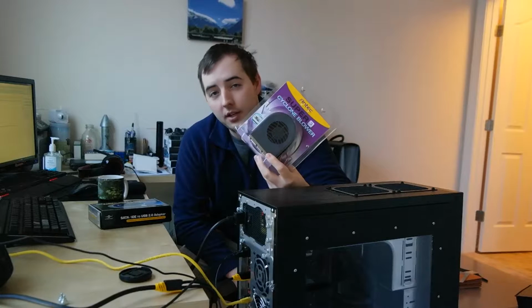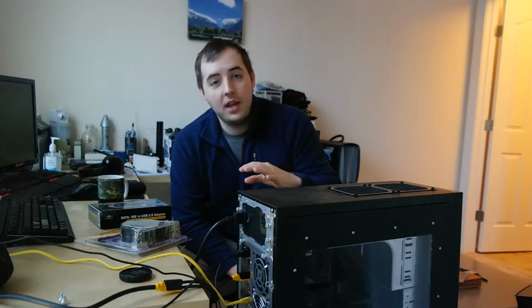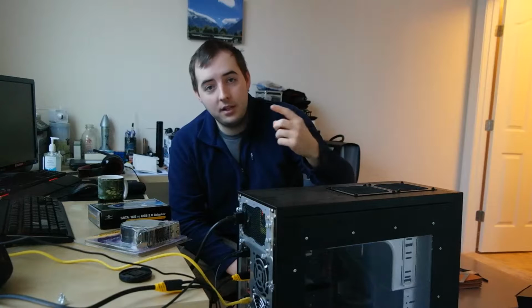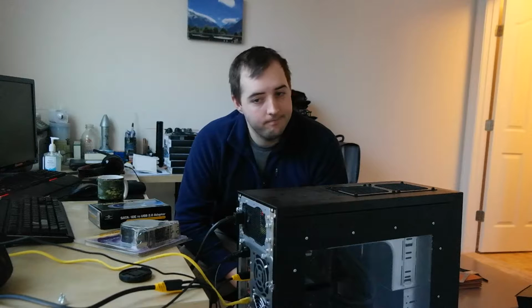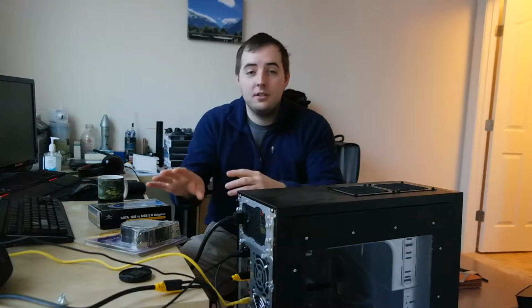What I'm really trying to do with this is just get the hot, stagnant air from the bottom of the case out. It'll be pulling from the same region that the GPU fans themselves are pulling air from to go up, only this will be pulling it down and out, so I don't know what that'll do. Hopefully this will mostly get better airflow underneath the GPU, and that's kind of the scope of this entire thing. Now, if this doesn't work, I've got a couple other ideas.